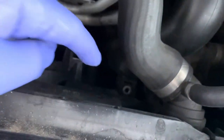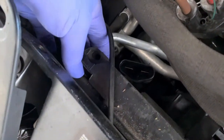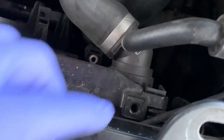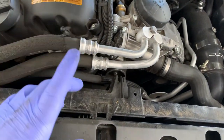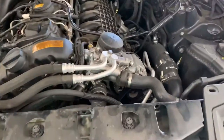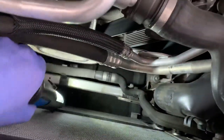Remove these T30 screws down here and disconnect. There's a little clip on the left side - just push it back and pull it up. The other one is down here, same thing. Then you can carefully maneuver the fan out - just lift the fan a little bit and put it backwards so you can clear this nose here, then take it out. As my luck has it, there's a little rubber grommet that fell on the floor - I'll get it later.